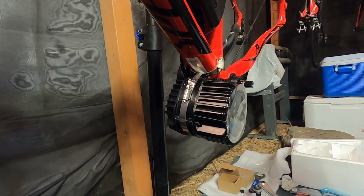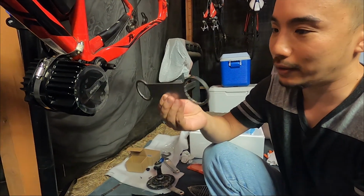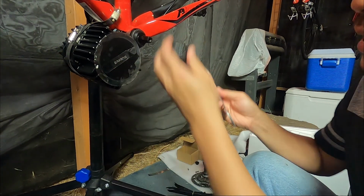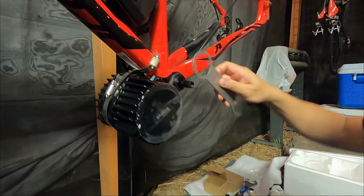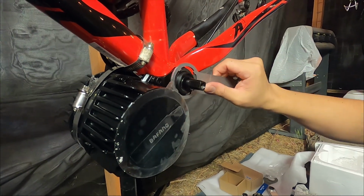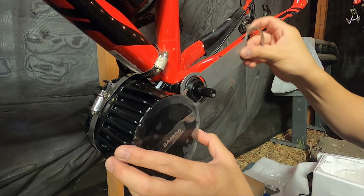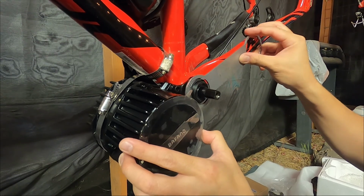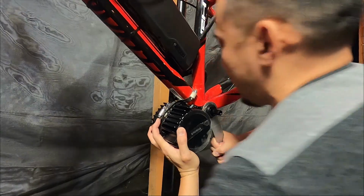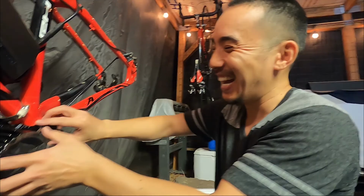Fitting right. What we didn't have also on Alvin's kit when we were doing his was this wrench here. This end is for the cap, which will end up going on top of here, but this side, what we did before was we were hammering around with a flat blade and a hammer, but this is the proper tool to do the job. All right, that's tight. That's about 6 inch-pounds.